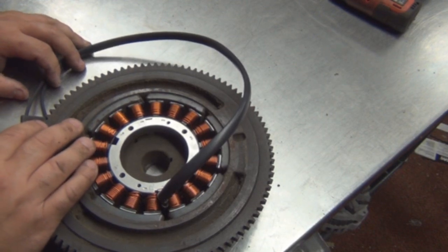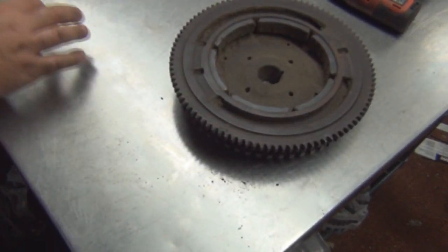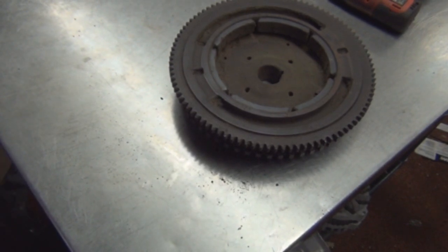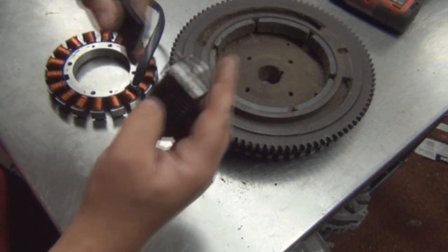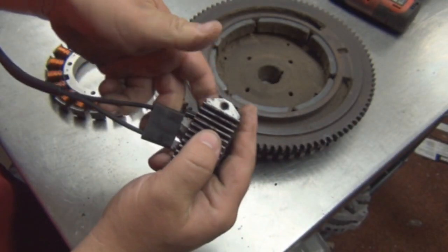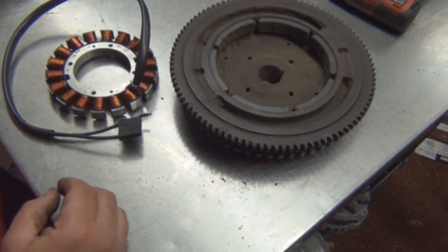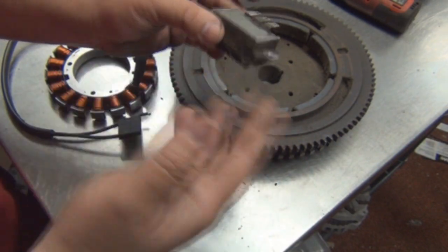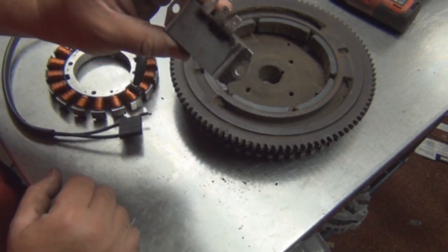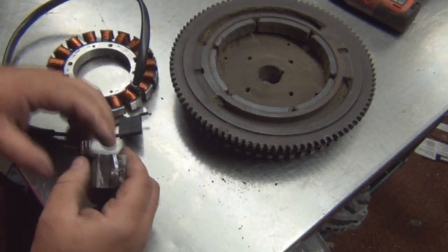The magnets create an alternating current that comes through this wire and goes into a regulator rectifier — I have one here. This is a regulator rectifier. You plug this into your regulator rectifier like so, and this one will go to your battery positive. It'll be a fused link. The voltage will go in here from the stator. This regulator rectifier has diodes and whatnot that turn it into direct current, which will charge your battery. The current comes in as alternating current and goes out as direct current.